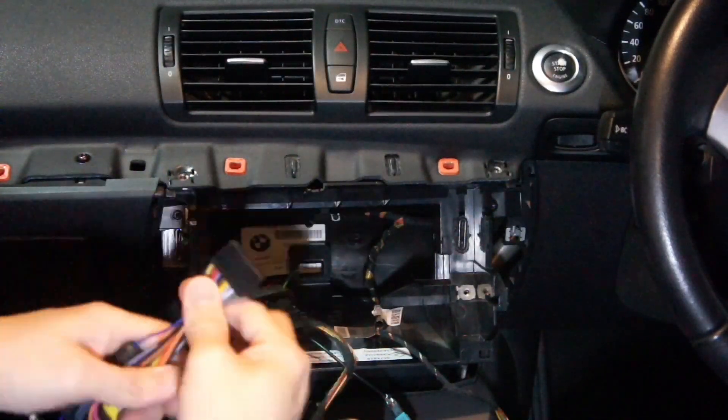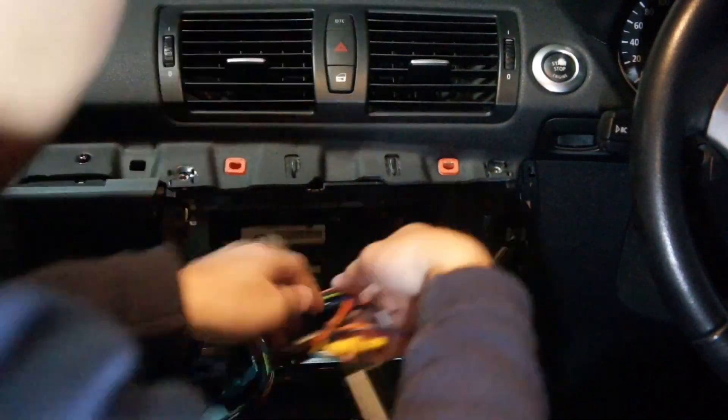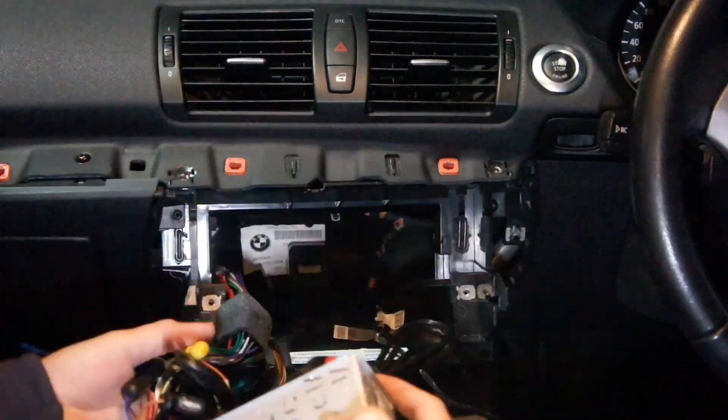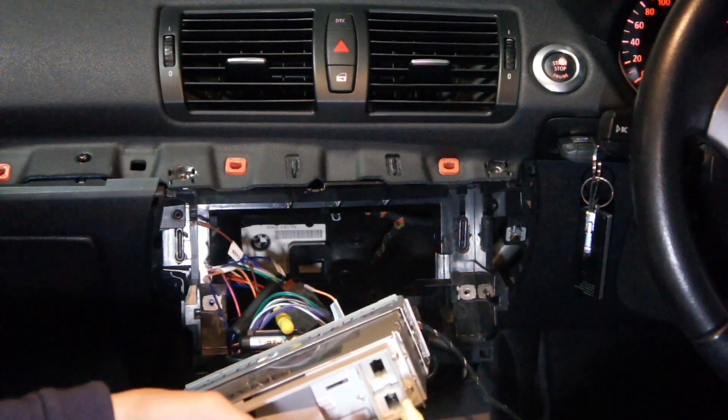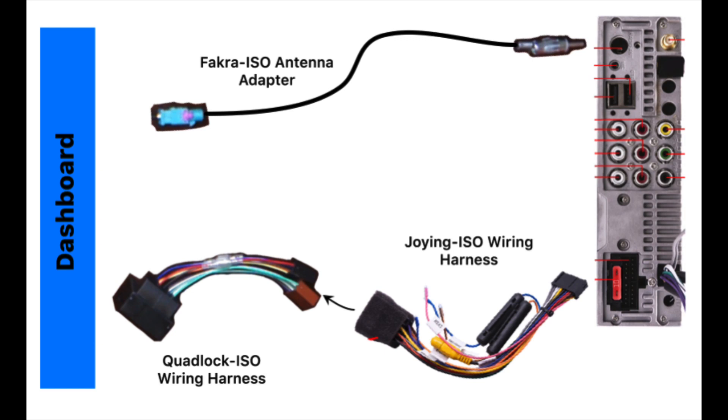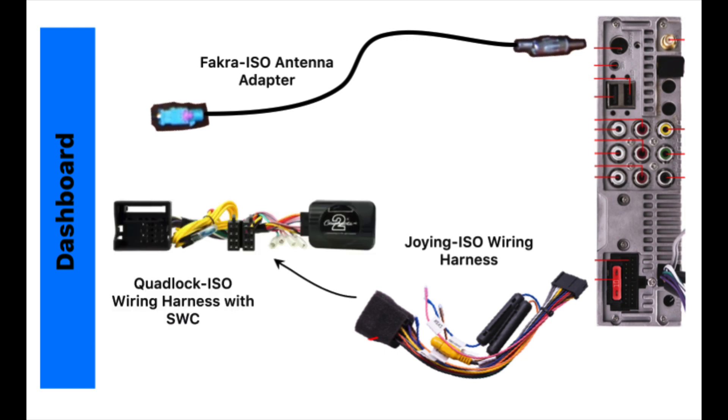There was a lot of toing and froing — they asked me to test this and test that. It was very frustrating and I was left with a head unit that wasn't working. So I had to buy another quad lock wiring harness; this time it came together with a CAN bus decoder for the steering wheel control, and the supplier selling this seems to be a reputable one. As expected, this wiring harness did its job and world order has been restored.